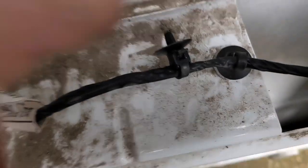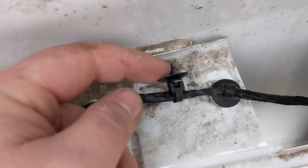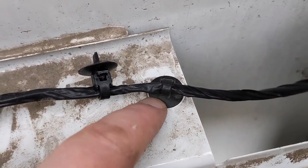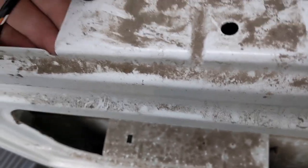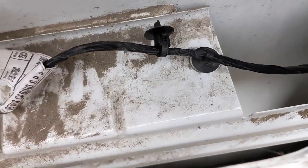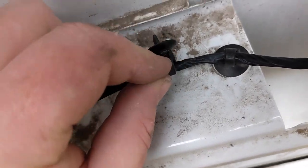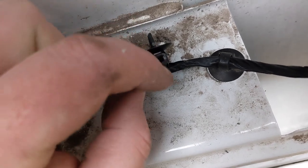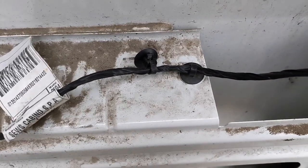Just another thing I've done on the new harness — I noticed that the little grommet here, that is part of the cable tidy, had its teeth snapped off, which must have happened in the removing process. So I've repurposed one of the ones that weren't snapped off. I had one left on the original harnesses. They're not the strongest unfortunately, but it just needs to hold it in place. I'll eventually get around to cutting that off but it's not doing any harm. The way I did that was just a cable tie — you get in there, pull it back with something pointy. I used the end of my multimeter and just pushed it back through. Keeps it nice and tidy.